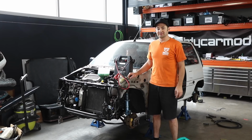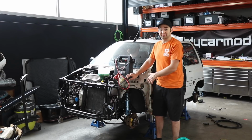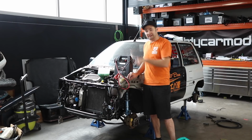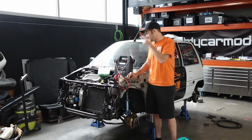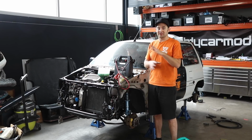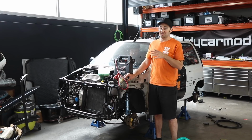The next thing we're going to do is kind of the most important one. It can only be made possible by changing that rear floor, and that is to check if the all-wheel drive system works. We've put coolant in it, we've run it up to temp, we know that the fan works, we know it's got fresh oil in there, we know the diff's got fresh oil in it. The transfer case is still a bit of a mystery. We don't know how any of that works. There's a random vacuum line hanging out of it and this vacuum reservoir, no idea what that does.